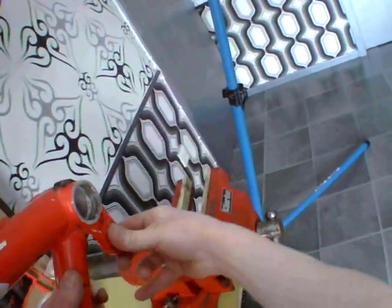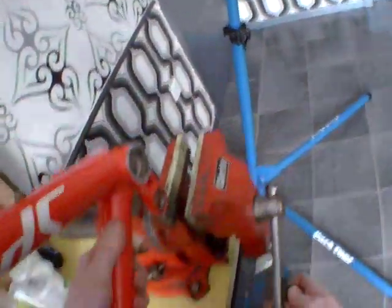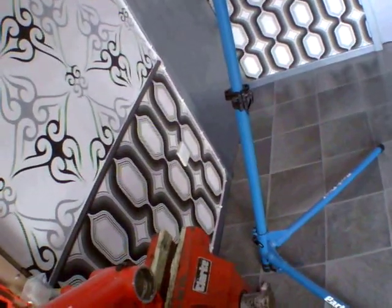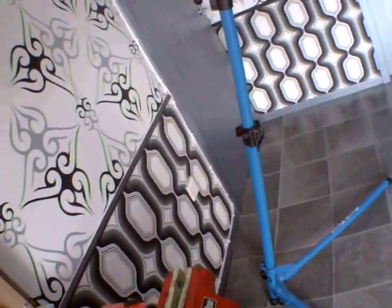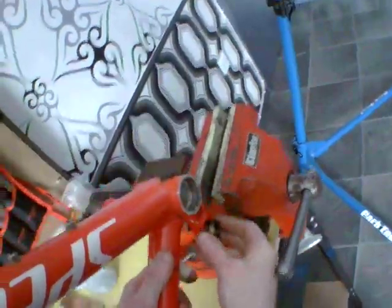Put your thumb on the housing — it won't go all the way in and you're not going to have the force to do that. Get it all onto your vise. Use an old bearing again — old bearings are the right size to use as drifts and you're not going to damage anything. You can use a socket set, but you can damage the race and the bearings by applying pressure that way.